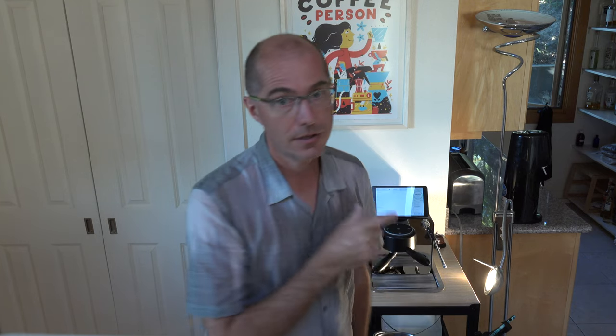E61s are really good in an environment which is making coffee at a very specific pace. And then your group head is staying a certain temperature. And that's why, for example, the E61 group heads never have any insulation on them, because they're actually meant to radiate heat. They're not actually meant to stay at heat. So heat comes out, they heat up at the 95 Celsius or whatever it is, or the water of the boiler, and then they're losing heat. They're bringing it down to a good temperature. Machines that have electrically heated group heads, like ours, are going to be much more consistent in giving you a temperature. So that's one. And the other is, I showed you earlier the temperature chart.